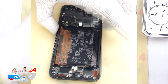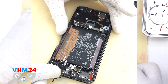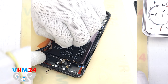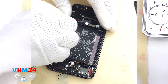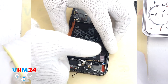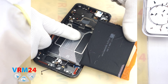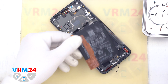Finally, we move on to detaching the battery. Traditionally for Xiaomi, we have brown tabs labeled A and B which we need to unfold. Tab B, located in the middle, we need to unfold so that it doesn't get in our way. Tab A, which is white, goes all the way around the edges and we need to pull it up. We carefully pull the white tab upwards and detach the battery. We can notice that under the battery there is an adhesive transparent coating protecting the interboard cables.